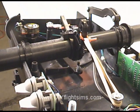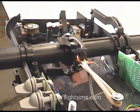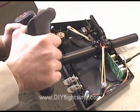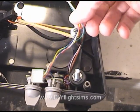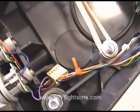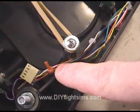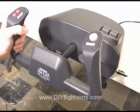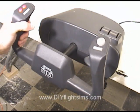Remember, this lever needs to be seated correctly on the bottom of the shaft and the sleeves need to sit in the grooves on the back of the unit. This wiring harness was disconnected from the mini levers removed in the previous video — we don't want it flopping around, so we attached it to these other wires with a zip tie and everything is tucked away nicely. Now the yoke has a better response to those subtle control inputs we use when the airplane is trimmed for cruise flight, or any time a soft touch is necessary.